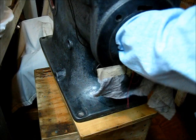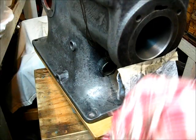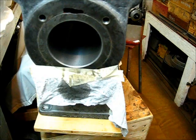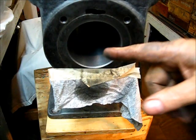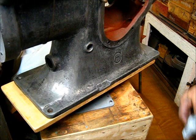Okay, let's wipe her out. See that black on there? That's how much that flex hone wore that cylinder that quickly. Let's get a light in there and look at her. The difference in the size of the cylinders — I can get my hand in these spark plug types but I cannot get my hand in the igniter type. Let's get a close-up now.